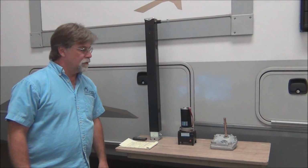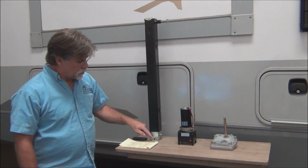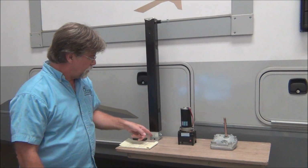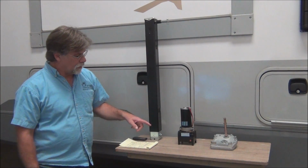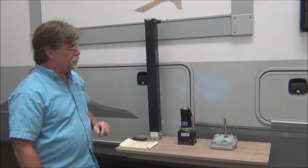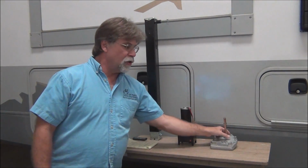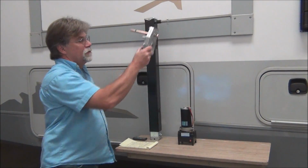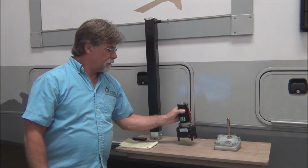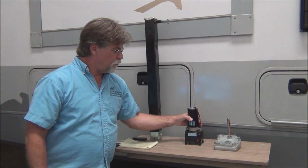The other main component is the jack itself, the telescopic piece. This is 3 sections. One is manually telescoped down and held with a pin. And then the other is the lead screw, which is in here, which raises and lowers the inner portion. So we'll take a closer look at that in a moment. The other two components are the gearbox, which, of course, mounts to your jack or leg, and then the motor and its associated gearbox. So those are the 4 main components.